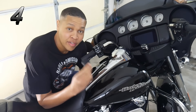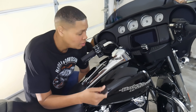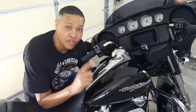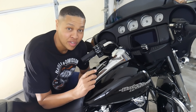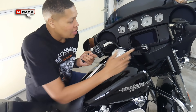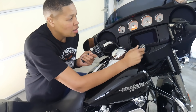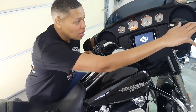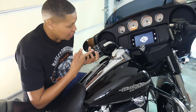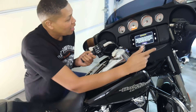Turn it back off and everything is set back to normal. Your Harley-Davidson comes with a key fob but it can also start with a PIN. You may have bought the bike used and not know the PIN number, so let me show you how to find it. First, make sure the run switch is in the off position. Then turn your ignition switch on and cycle your run switch: run, off, run, off, run.